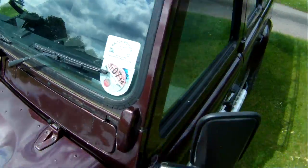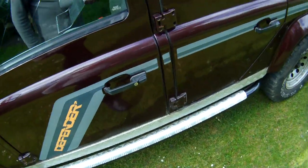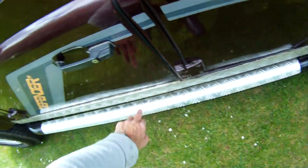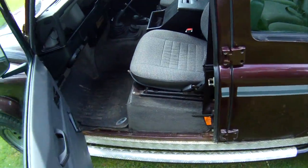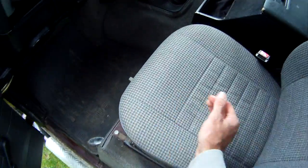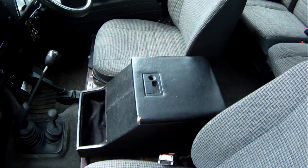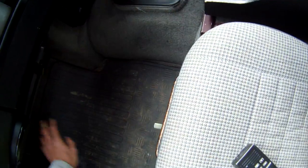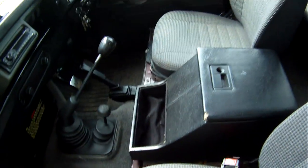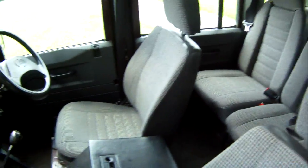The scuttle corner itself on the side looks very good indeed, and the A-post all looks very nice. The nearside door all looks fine — tiny bit of electrolytic reaction down the bottom corner, but not up the top. The bottom hinge pin could do with replacing; the door opens and closes fine but the bottom hinge pin is quite worn. Inside here, the interior is really rather nice — the headlining is good, all the seats are in nice shape. The cubby box has lost a bit of its vinyl trim on the edge, but it's even got its front carpet mat. All the County Station Wagon-specific trim is still in place; it's one of the nicer interiors I've seen for some while.